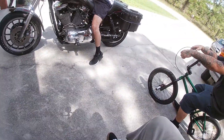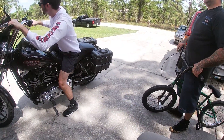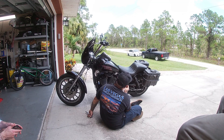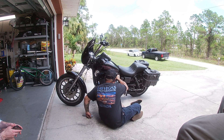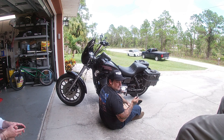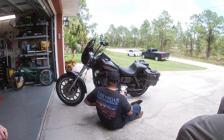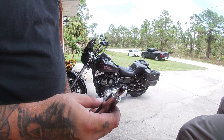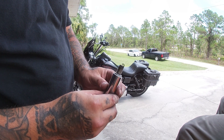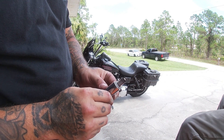So we think it might be the carb or the gas — turns out the gas wasn't on. Once we turned the gas on it was a lot better. We took the spark plug out because the bike has a little tuning issue — it's sneezing a little bit. Looking at the spark plug, it's a little white, so she's running lean. We're going to open up the fuel-air mixture and enrich it.